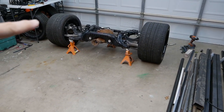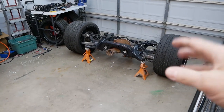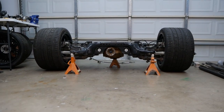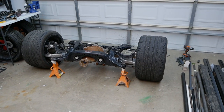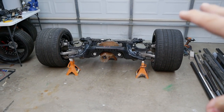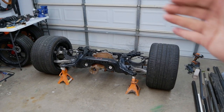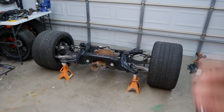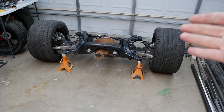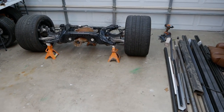There's really no difference between that and the GT Performance Pack or Track Pack, but it has bigger axles than a Torsen rear end. As a package it's exactly what I wanted — it's very thin, which helps keep the weight down low and the center of gravity really low, and makes it easy to replace all the components. The issue with my other chassis design was that all my dampeners and suspension components were up really high. This is a really compact package, and being Ford, it's very easy to get parts for — not super expensive if you break something.